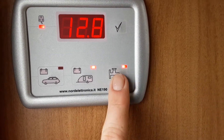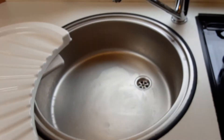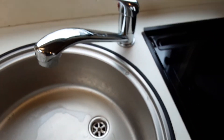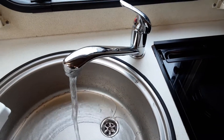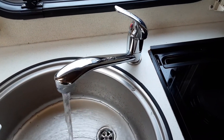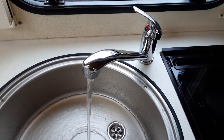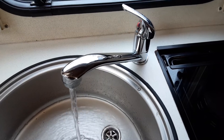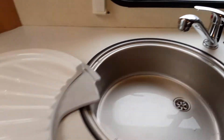You'll also notice there's a water pump switch which I'll come back to in a moment. The water is connected on the outside of the caravan. To fill the water system, one of the first things you need to do is open all the taps up on the hot side. Normally when you come to the van there'll be no water in it, as you need to drain it down after prior use, so open all the taps on the hot side.